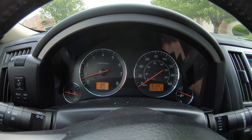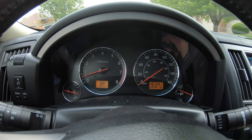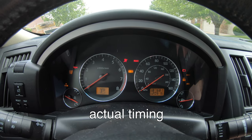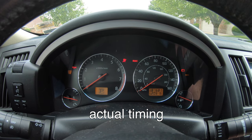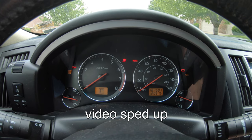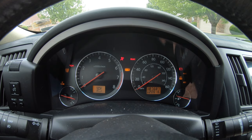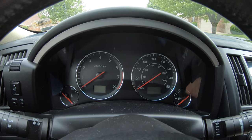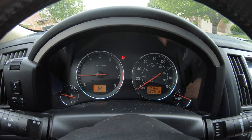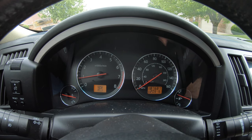I was about to publish my video this morning and I had to run an errand — I hadn't driven the car since I took the seat out — but I noticed the airbag light was blinking. I think this is because I had the seat unplugged and there's a sensor related to the airbag system. I read an instruction online that said turn the car to ignition, and as soon as the airbag light goes off, turn it off and do this four more times. And I just restart the car and see if the airbag light stays off — and it looks like it has reset itself.